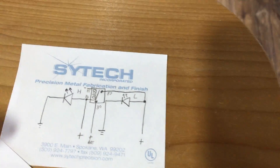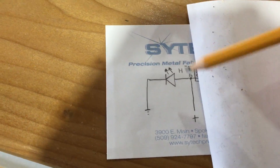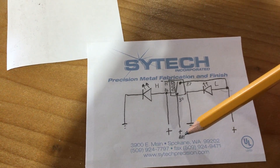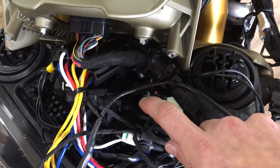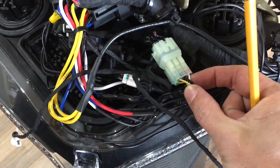I'll show you the wiring diagram for that. It looks a little complicated but it's really not if you just break it down into parts. This is the low beam circuit — the bike just provides a positive to the LED and goes to the negative. Same with the high beam — the bike just provides a positive, goes through the LED, goes to negative. So what you do is throw a relay in there, and again be absolutely sure to pull your power for the relay directly from the battery. These wires are really really small and they're not big enough to power both the high beam and the low beam.